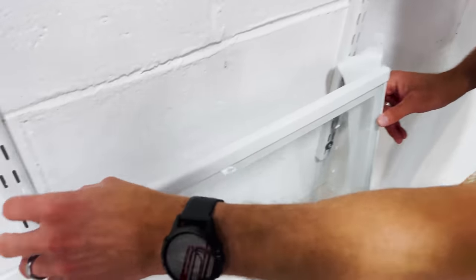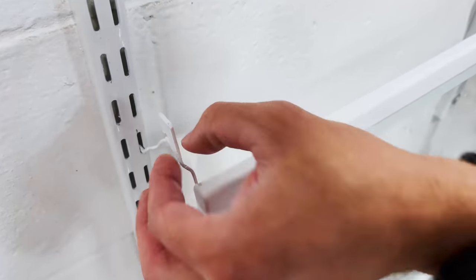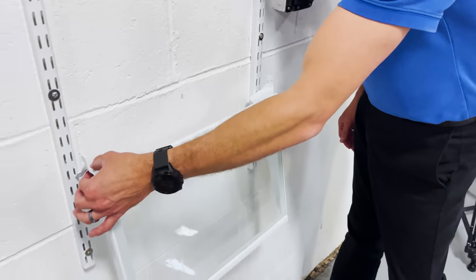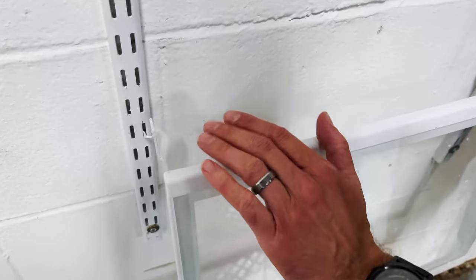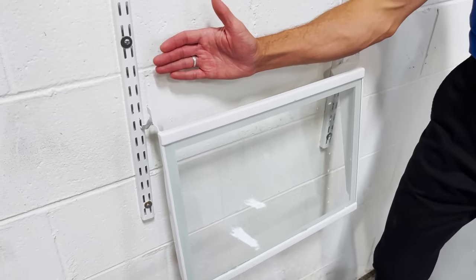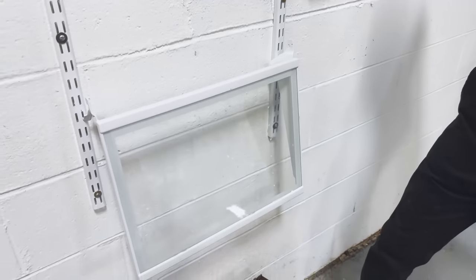So the failure of this happened across the larger length of the beam. And as stated earlier, the Electrolux Frigidaire design had a gusset here and then a longer gusset there, and they had a short section of a thinner cross section of the beam where they had all of their stress concentration, whereas this cross section was consistent all the way through the beam and it was able to distribute the stress more evenly. Rather than creating a stress concentration between the two gussets, this distributed further down the beam, and you can see, as a result, the deformation is in a larger area, which is probably why it was able to hold a larger load.